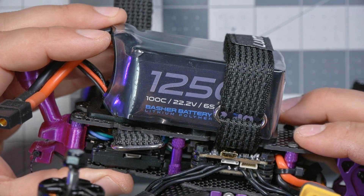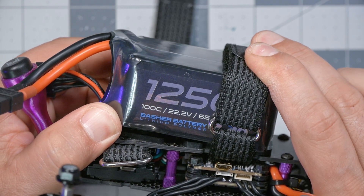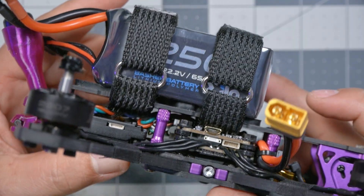Here is the reason why two battery straps are more than twice as strong as one. I've intentionally put this battery strap near the front of the battery to exaggerate the effect, but the effect is true even if the strap is right in the center. In a crash, the battery experiences a lot of force — you could be going 60, 70, 80 miles an hour and suddenly stop. That deceleration tends to make the battery want to lever out. You get a nutcracker situation where all the leverage is focused at that joint, which can cause straps to break or let go. With two straps, one at the front and one at the back, it prevents that levering situation. Always use two battery straps.